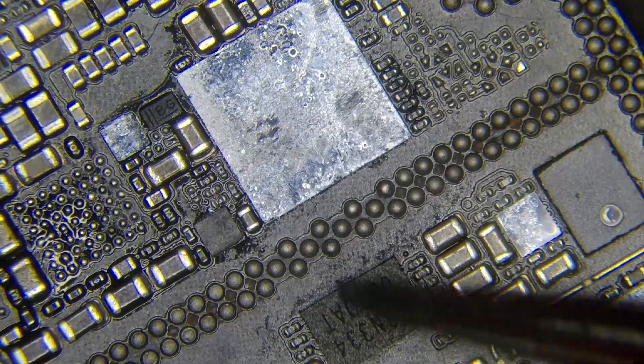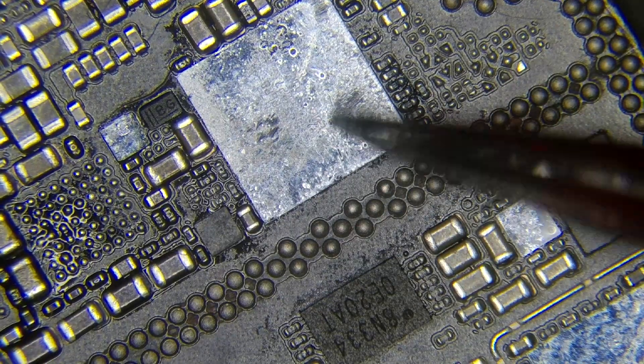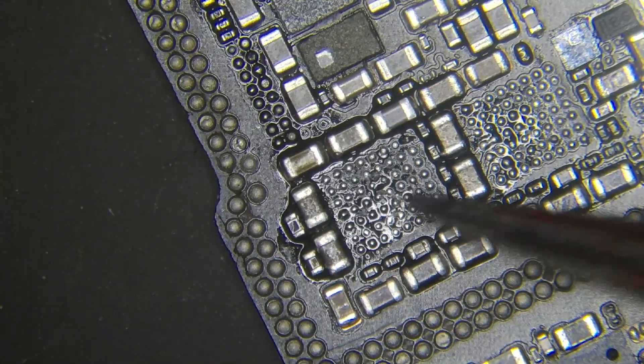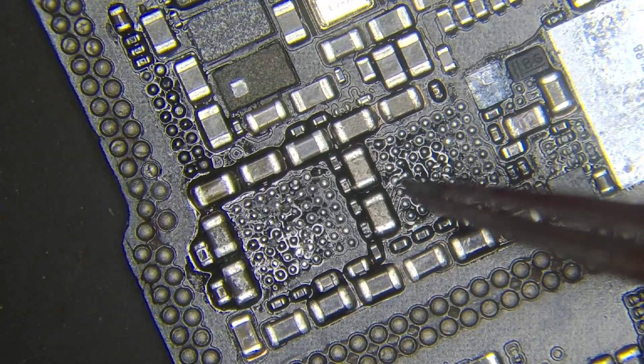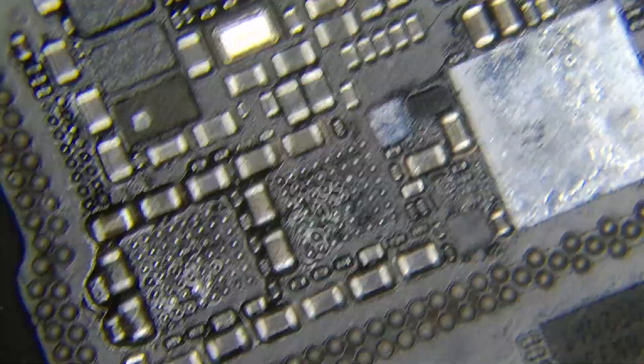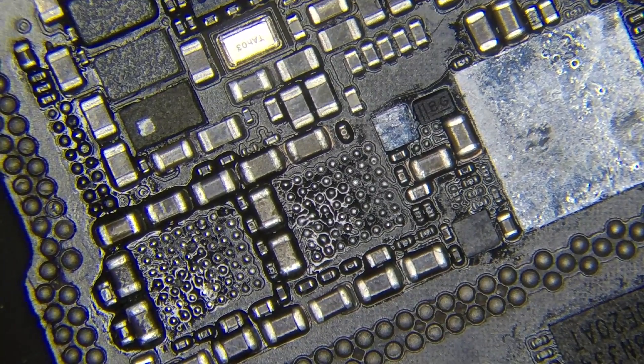There are two pairing circuits. I removed the speaker amplifier because they told me they just did a reflow on it — so please don't do reflow. I already turned on this phone and the problem is I have 90 milliamps on my power supply. Sometimes 90 milliamps means the phone is stuck in DFU mode.